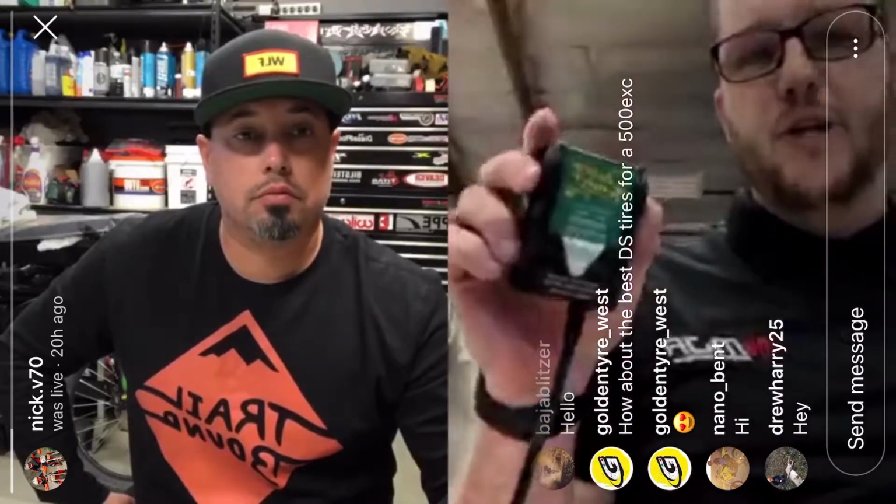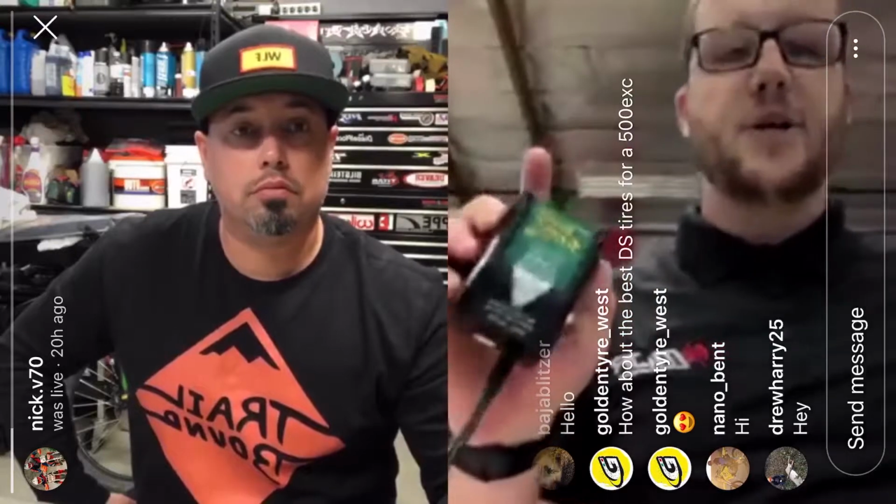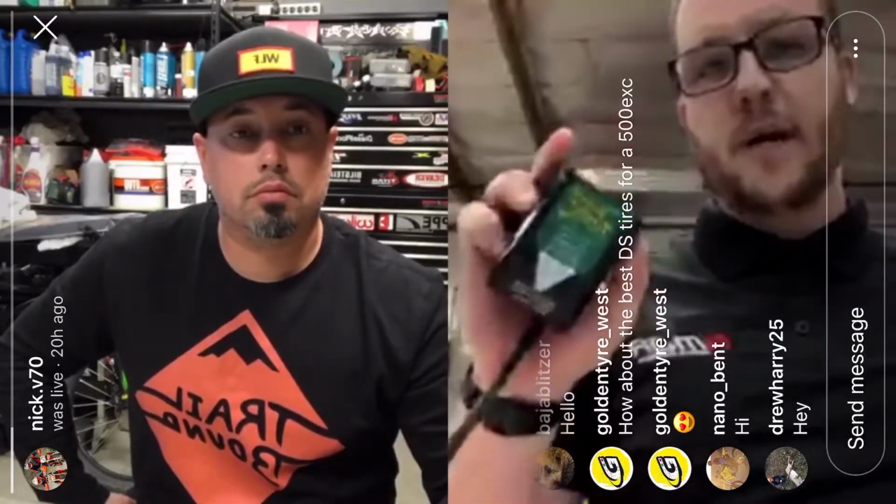Right. As far as the charging, the biggest thing, if you know you have a lithium ion battery, is to make sure that no matter what charger you're using, it has the capability to charge a lithium ion battery. There's a lot of chargers out there that don't, especially if you're coming off an older bike. This is a standard Battery Tender Junior, and this one will not charge a lithium ion battery. You have to be careful, because if you try charging a lithium ion battery with it, you could risk damaging your battery. So we have a special charger, which I'll grab.